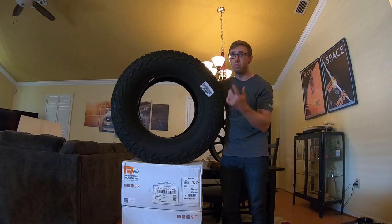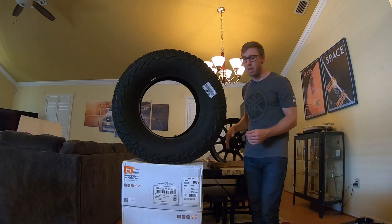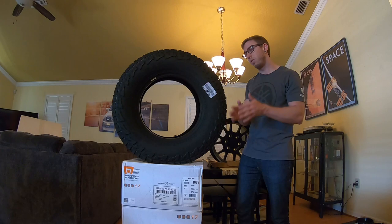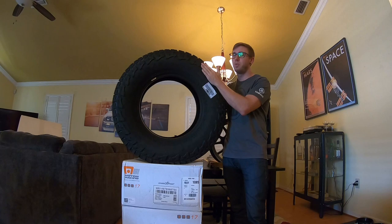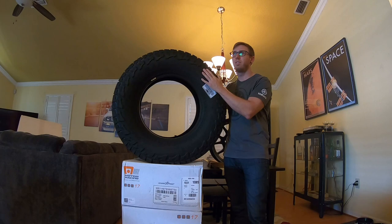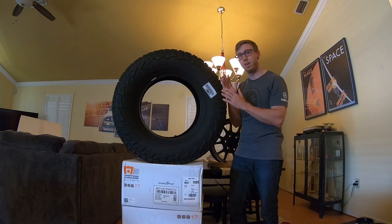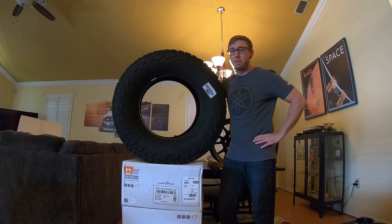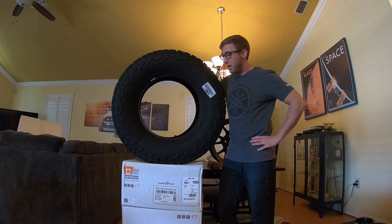And also, the biggest thing I forgot to even mention, with the Motegi wheels, I went with a zero offset. The stock wheels are plus 25 offset, and so that 25 millimeter difference puts you close to an inch of pulling outwards. So the extra from a 265 to 285, I grew about the same amount, a little bit less actually. So the offset, I'm hoping, I don't know, we'll see. I was hoping that the wheel offset I went with would pull the wheel away from the inside of the fender a little bit more, so that maybe I don't have as much rub as some people are having with throwing 285 70 17s. But either way, I will document what I do.